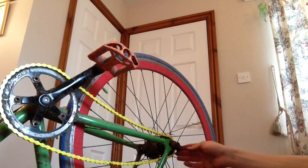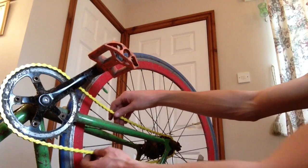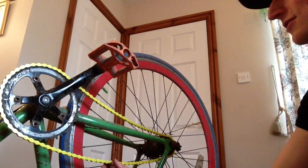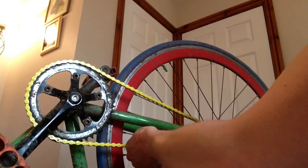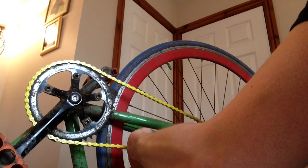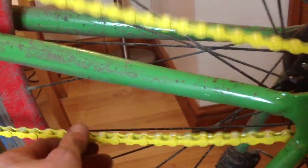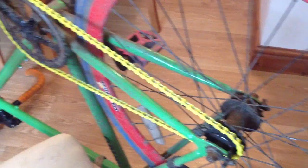You need to make sure that the links you've got aren't two of the same type, because there are outer and inner links — you need an inner to link up to an outer. As you can see, this is as simple as it comes. It's really just the trickiness and fiddliness of trying to hold everything in place while you do it. Don't fall into the trap that I've known one friend fall into — when they got a chain that was in a single strip like this yellow one, and thought it'll be much easier to link it up into a circular chain before putting it on the bike. But you might discover it needs to thread through the back part of the bike frame first before you link it up. And here we finally have it — a lot of fiddling around and I ended up taking two links out. But that's looking pretty good. It's just a case now of tightening these back up until it's a nice sensible tension, and then locking the wheel back in place.